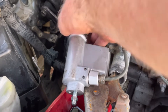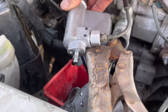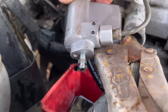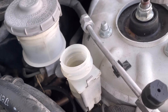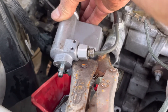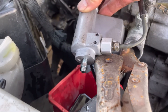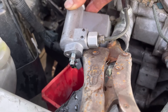Fill the reservoir, then compress the ram with the valve open to get the air out. Then close the bleeder and let the piston out — when that happens it draws fluid from your reservoir. Tighten up your bleeder, then open the bleeder and press the piston, and out will come air and fluid. Before you let the piston back out, tighten up the bleeder.